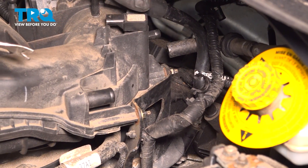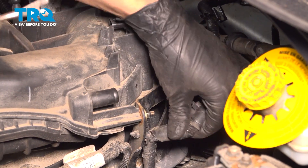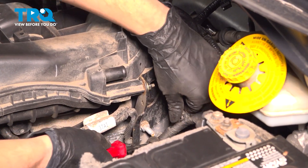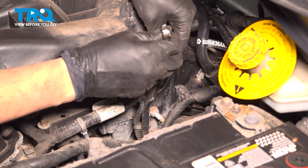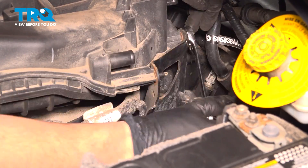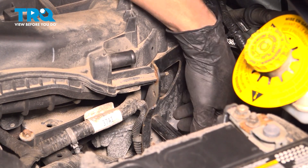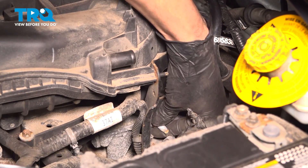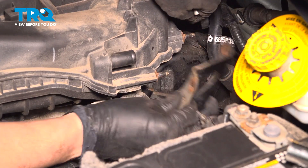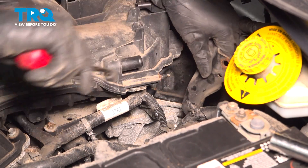On the back side of the manifold where the throttle body is, you'll notice a similar bracket setup with two 10mm nuts. We're going to have to pull this bracket off. I'm going to take the retainer for this wire off. There's also another one right down here, which exposes its main anchor point. I'm going to take the two 10mm bolts off, and now let's take off that 13mm down there. With that out, pull the bracket off — looks like there's one more wire attached to it. Pull that out and now remove the bracket.